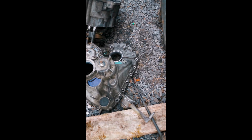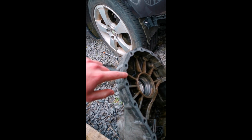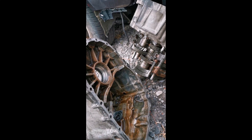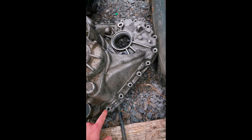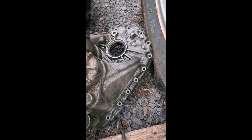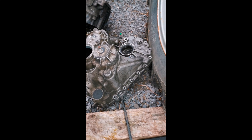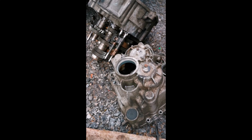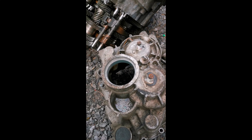I didn't get to run through this last time on video because the phone died. Basically all I did to finish off was put sealant around this edge all the way around, then torque up the screws — I think it was 35 Newton metres. I went in an alternating order, tightening them all a bit first and then torquing them up afterwards. For the end cap, just line it up as best you can, grab a mallet and tap it in — that's all you have to do.